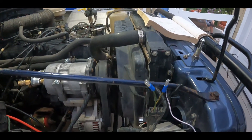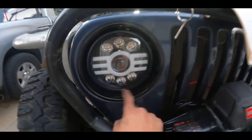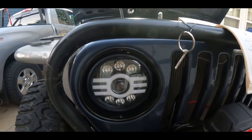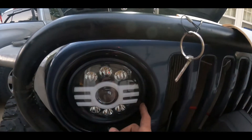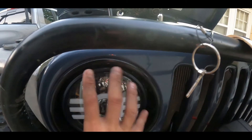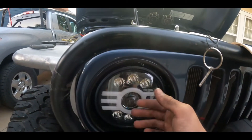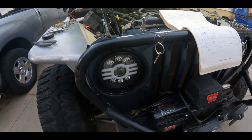For pulling the actual headlight out, it's pretty simple. You've got a screw here, one here, and one here, and this bezel will come out — those are usually Torx, I think they're a T15 on the factory. If you still have the factory bolts, mine are Phillips, so those just pop right out. Then once that bezel is out, there's a retaining ring — you can see mine is blue — with four screws spread around it. Pull that out and your headlight should pop out. Be careful you don't want to drop it, since you've usually got glass or plastic lenses you don't want to break or scratch.